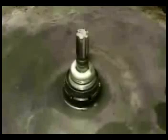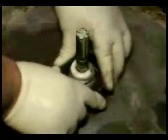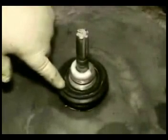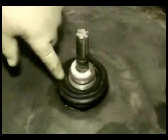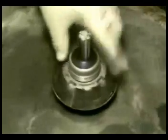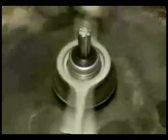To install the seal, set it in place. Turn it left and right while pushing it down until it's all the way in. Be careful you don't break the carbon ring. If you do so, the seal will be ruined. Install the stem. Use a spanner nut wrench to tighten the stem. Then install the set screw.